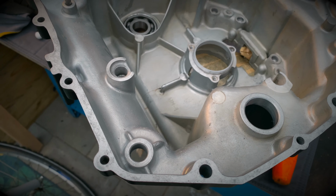Right, mechanical seal. This has just come out of the oven, as recommended. There's apparently two sizes of holes. Earlier models had a smaller diameter, so it's worth just checking. It's flipping hot, 220 degrees. So it's, yeah, what is it? 28.6, so that's fine. The new one, 28.6, so in theory it should just drop in this.